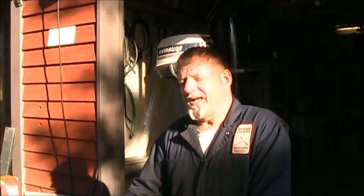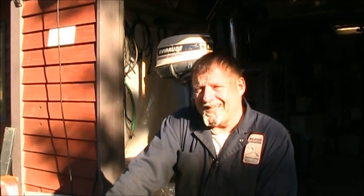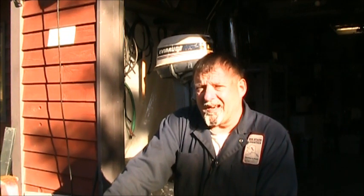Does have a lot of good things going for it. I think with a head gasket change, and that wouldn't take me that long to do, half hour labor and the gasket. With the head gasket change, I think even if that compression lower cylinder, maybe it was overheated at some point, maybe it has a partially stuck ring or something, maybe some carbon broke off in there and the cylinder wall's a little scored on the exhaust side or something. Even with that, being that you're looking at about 95 and 120, that's a lot of life left still in this old tired motor.